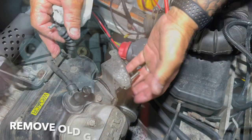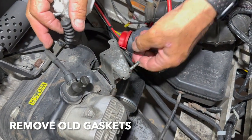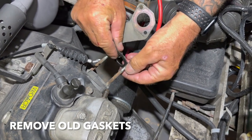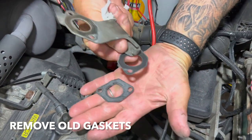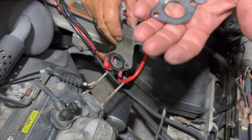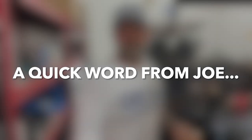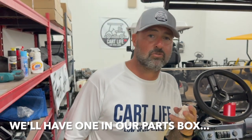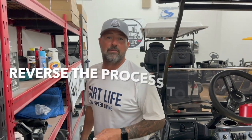Don't forget there are two gaskets used to install a carburetor. One is behind the bracket on the motor — take that one off right now. The next one is behind the carburetor, between the carburetor and the bracket. We will be taking a spare one on the trip with us because it's such a cheap and easy job — 15 minutes on and off, you can do it on the side of the road with literally two tools. So we'll have an extra one with us.